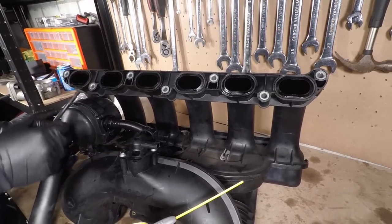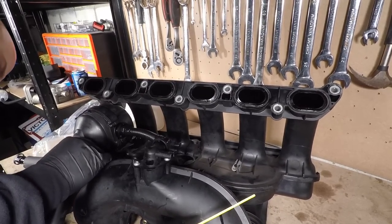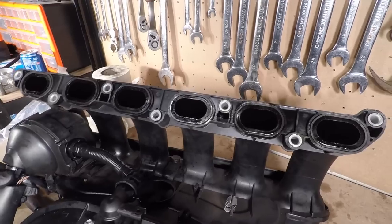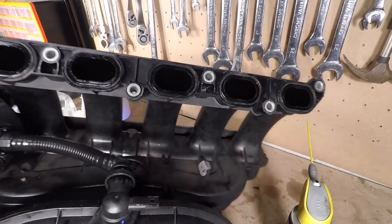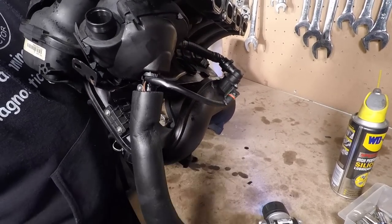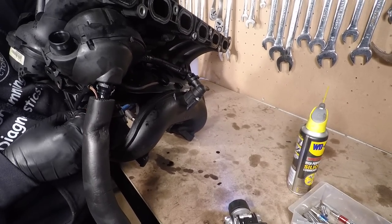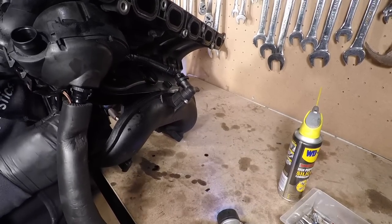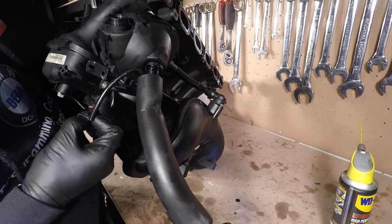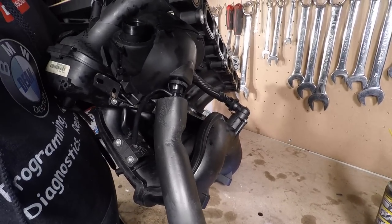This pipe goes to the top of the crankcase but we're not refitting that straight away. Make sure all the wiring is plugged up correctly at the back. Work out how it goes back to the oil drain pan — it goes back to the drain pan this way, and down. Pull it out until you find the correct connector for it — which is this one. It'll tell you which one it goes in, so you don't have to worry too much about that.